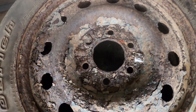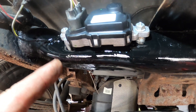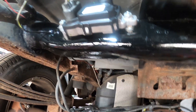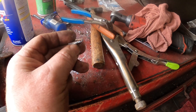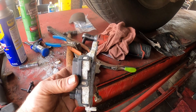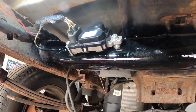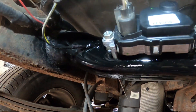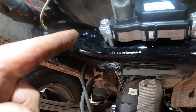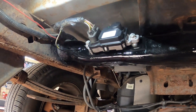Let's put the spare tire back on — he really needs to think about getting a spare rim, but there we go everybody. That's how you put a fuel pump control module in these Fords — the vans have them, the trucks have them, they're all mounted underneath like this. Look how thick this corrosion is — that caused the old one to break open, probably moisture getting in. Always get the Ford part because then you get the standoff bolts, and if you think you need to redo that ground, I would definitely redo it — I did not want to come back in here a second time. Thanks for watching, please subscribe and give me a thumbs up if you like my automotive videos.